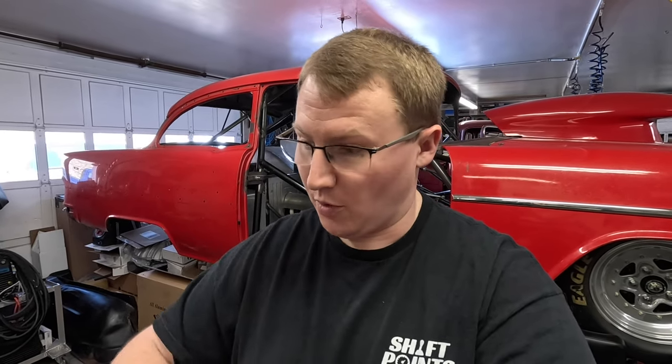The second reason is you'd be absolutely amazed at how much air comes in through these vent windows. When I got my truck they were completely ruined — I put new ones in and it completely changed the sound and everything. There are three rivets holding this window frame in place. I'm going to drill those out, get this assembly taken apart into its two pieces, get the seals put back in, and probably scuff and paint these frames a little since they're a bit rusty on this side.